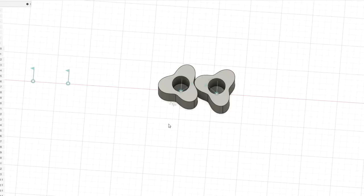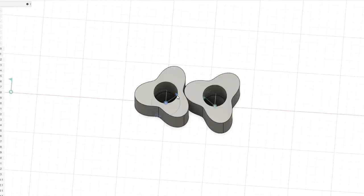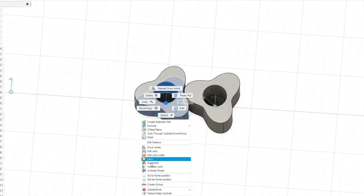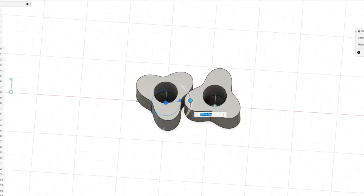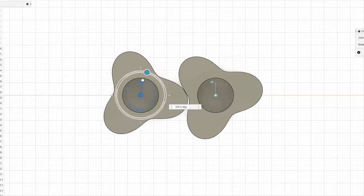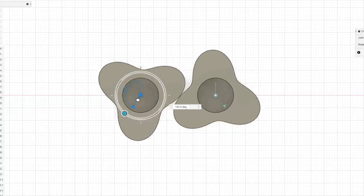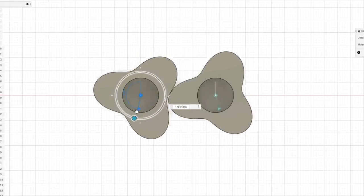The gears that we're going to be using for this dry sump are going to be these ones. These are gears that I made in a previous video that were meant for an E55 to replace the scavenging gears in that one, so that the gears make less noise. Showing you guys how these move, this is how these gears move together. The really cool thing about these ones is that they actually don't make contact with each other. They're spinning on two shafts that are already linked and spinning at constant speeds, and they always keep a certain clearance in between them so that fluid can't really flow in between them, but the gears aren't really hitting each other. That's why they don't really wear out, and they pretty much last for a really long time.